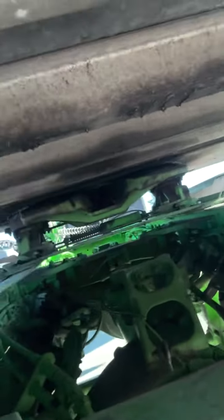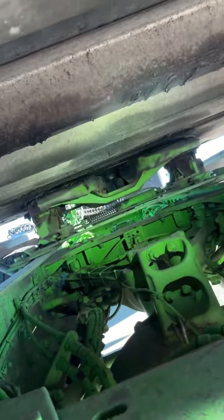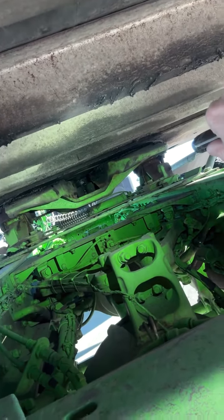Now let's go take a look at this. I raised up the suspension, backed up, and got hooked up. Here's what we've got — those bags are smashed. I always talk about carrying one of these flashlights with you. Let's get underneath the trailer and make sure that our fifth wheel jaws are connected — super important.